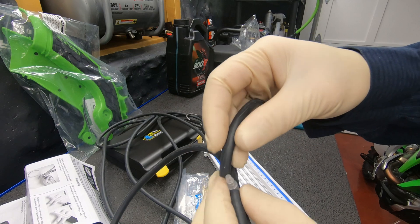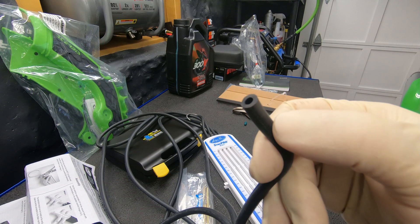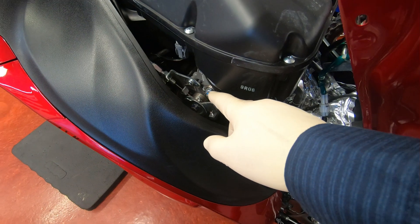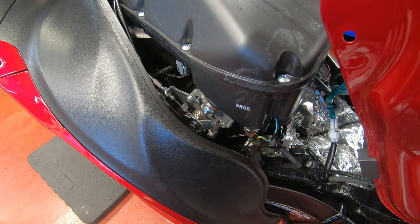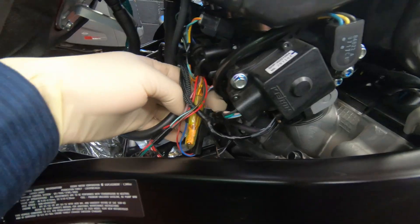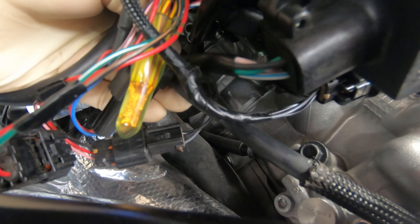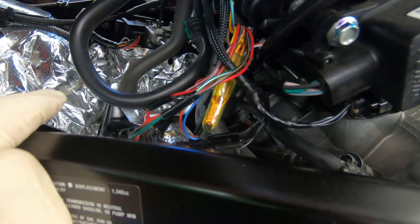With the small calibration hose provided, you plug it into the throttle body that has the cables on it — on my Hayabusa that's the one on the side; on some other bikes it can be in the middle. Before calibrating, I'll show you how I removed all the vacuum hoses where the tool plugs in. Those hoses were really hard to remove, so I'll show the technique I used.